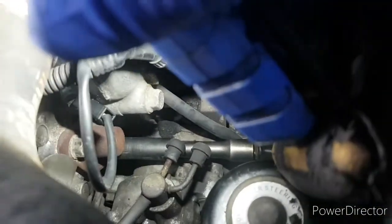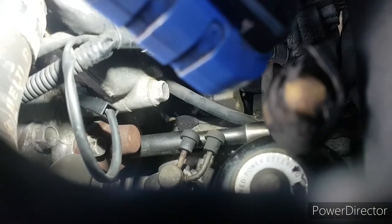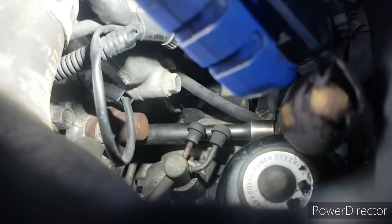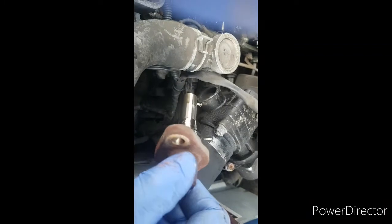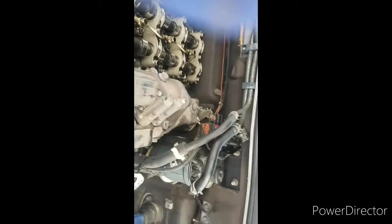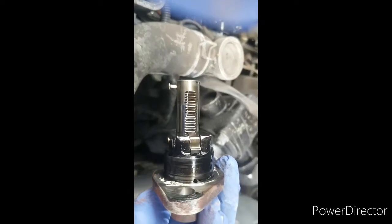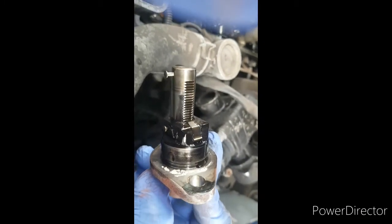I'll put that on. My socket there in extension is 12mm on the bottom bolt of the timing chain tensioner, and you can see the top bolt of it there. I'm going to undo that now and have a look. Here we are guys - I've just pulled it out, haven't let go of it yet. I'll probably have to reference this video when I put it back in, but that is the way mine goes - it has that little peg facing towards the bulkhead, or facing away from me. There's the teeth, and I've seen the video on how to reset this.